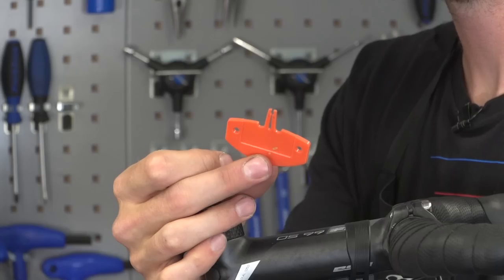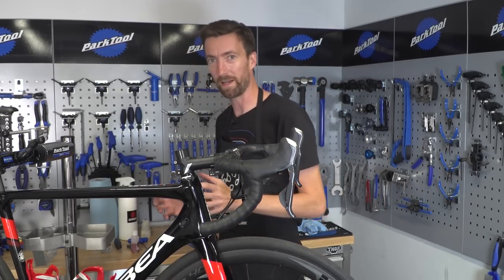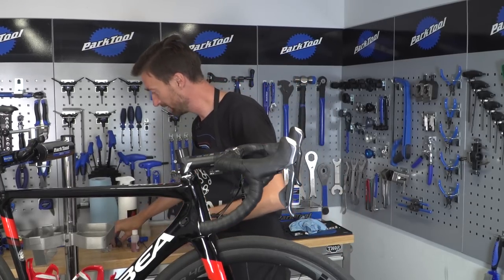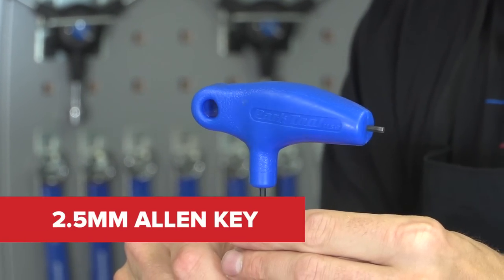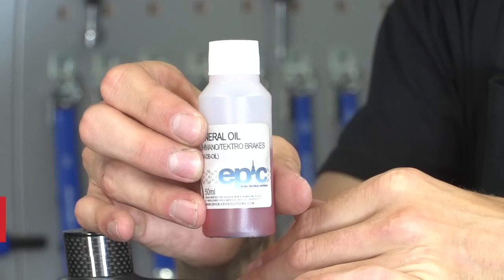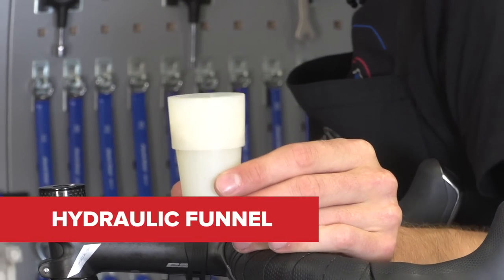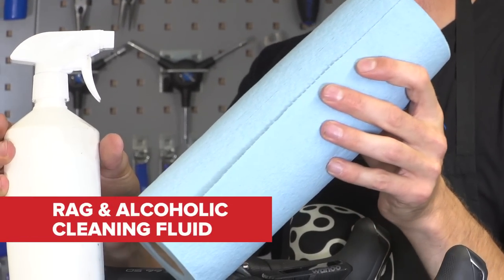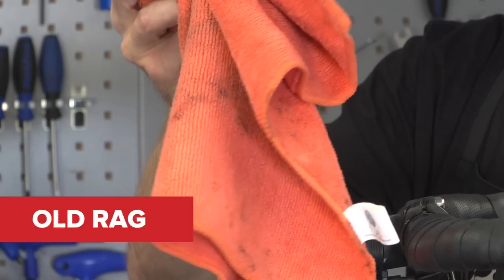You'll also need a travel spacer for the disc brake pads. If things don't go to plan, there could be some more tools needed: a very small flat-headed screwdriver, a 2.5-millimeter Allen key, a bleeding block, some disc brake hydraulic mineral oil, the hydraulic funnel, possibly a magnet, some rag, and some alcohol-based cleaning fluid.